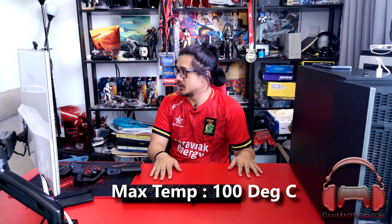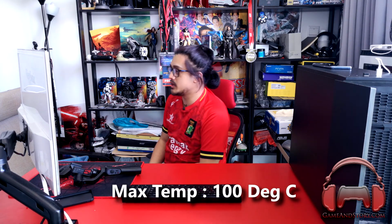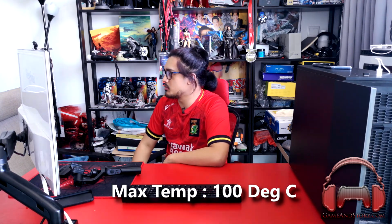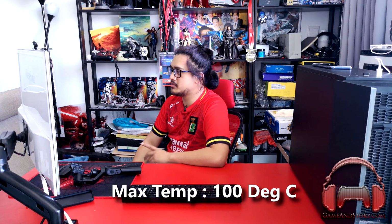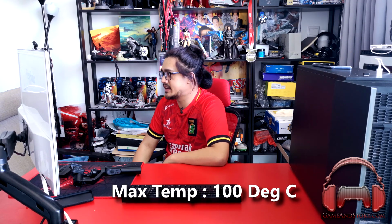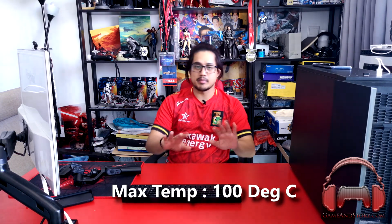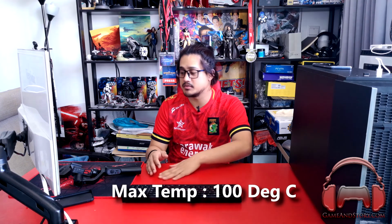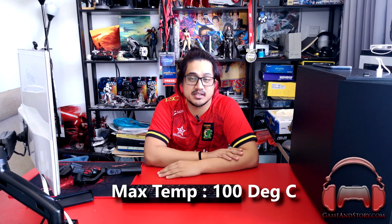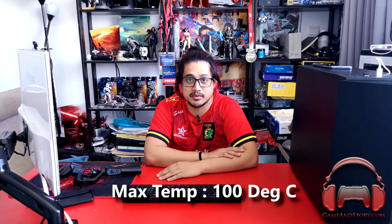That's all. Yeah, we've been running for about 15 minutes now. We hit thermal throttling on one of the cores, 100 degrees. Core number 1 is at 93 max, core number 2 hit 100, core number 3 hit 99, and core number 4 has hit 92. Okay, so clearly Prime 95 is doing its job. It's stressing out the CPU as best as it can. I think that's probably the highest temperatures we'll see for today, but we'll let it run a little bit longer, see whether the rest of the cores catch up in temp.